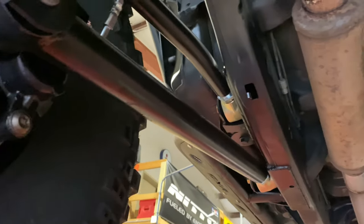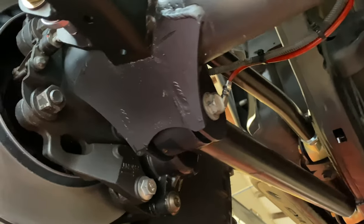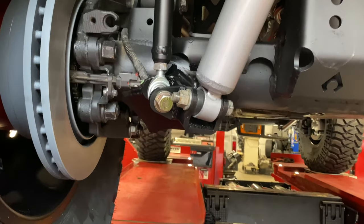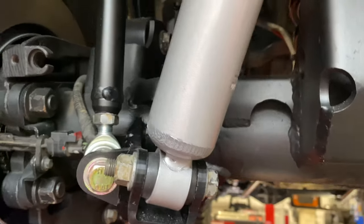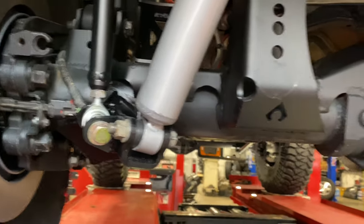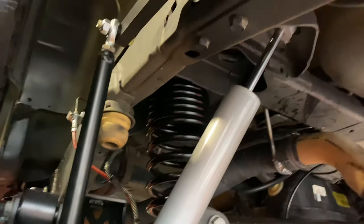This has the Evo long arm that was added on this trip. So really flush mounted frame brackets, thick, strong arms with Johnny joints. And then this lower mount that doesn't really hang down too far past the axle. So this one also, since it does not have the Evo lever system in it, we bought some shock mounts. I believe those are just Rusty's quarter inch shock mounts with a Genright sway bar. Sway bar mounts are welded to those shock mounts, welded to the axle, and that's a Genright sway bar.